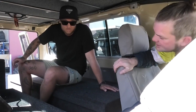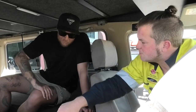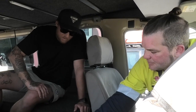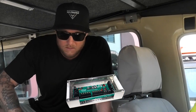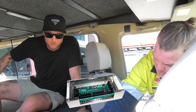We've also used an Egan DC hub for you — that is where all the connections come together. Your manager, your fridge, all your charge ports, all the lights — everything runs together in this one spot and all the fuses are here. So if you ever have to find a fault on the system, the Egan DC hub is the point to go to. And if a fuse blows, a red LED comes on so you know exactly where to go. That's pretty much foolproof.